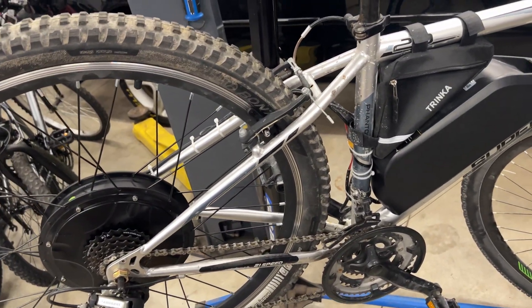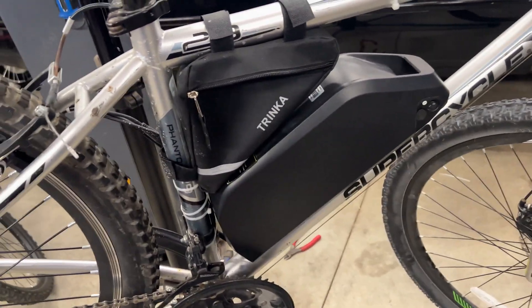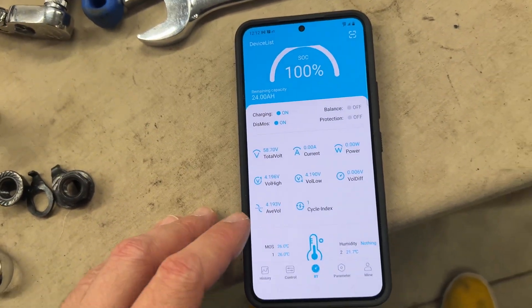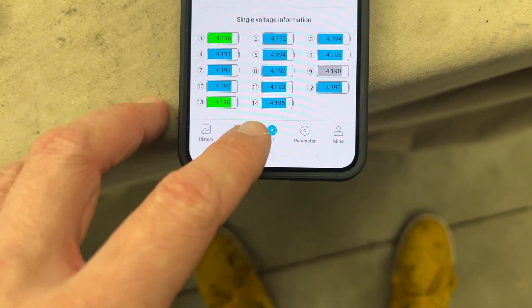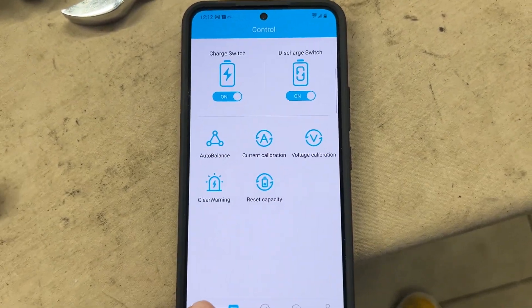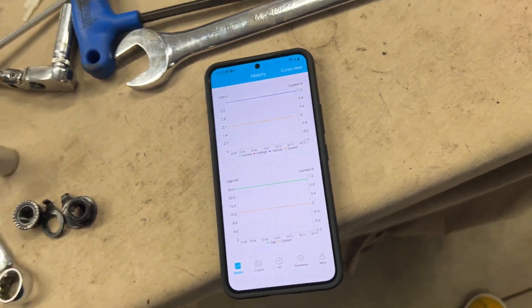Okay, so here it is — it's done. We've been riding it for a while now and it's pretty fast, it's nice. It handles pretty well for what it is. Ended up with a 52 volt, 24 amp hour battery. This battery is really cool — it actually has an app, so you can see all the individual cells and their charge. Weird thing is, this battery came with two switches off, so we thought it was broken because it wouldn't charge because the charge switch was off. But yeah, it was just a thing in the app. Lots of data you can read on there.